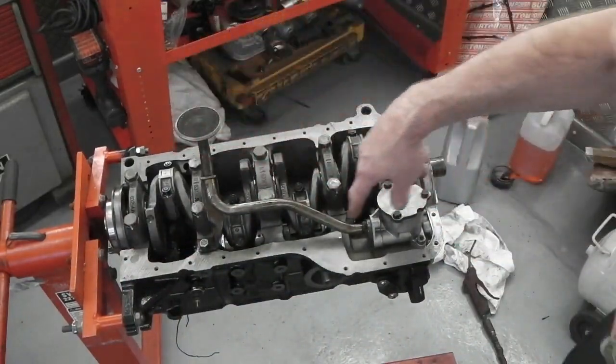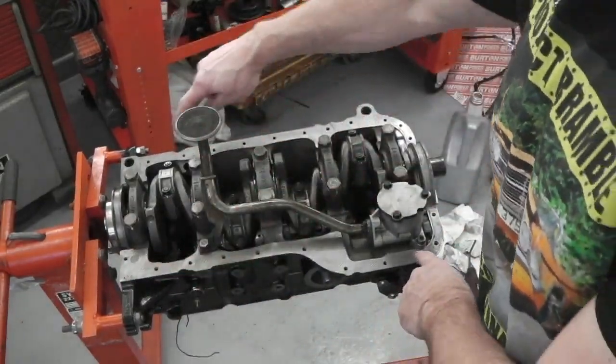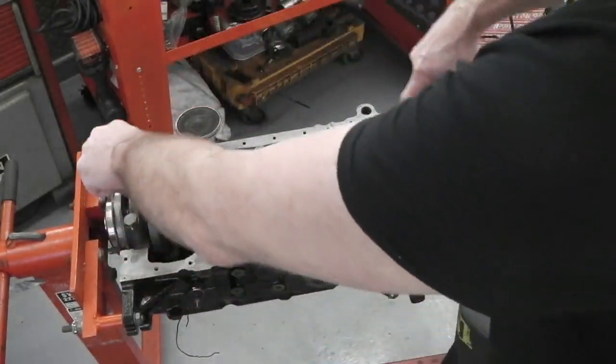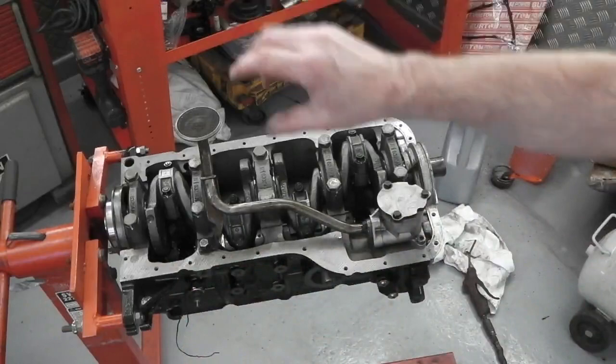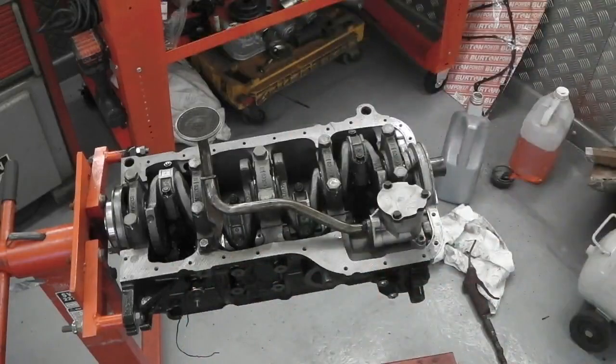A gasket at the end, some little keystone things to put in for the gaskets. Then a sequence to tighten up the bolts on the pan. I think you're starting in opposite corners and going round. We need to dig out the bolts now for this. The sump's in the wings just over there off screen, and we'll put it together.